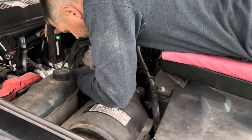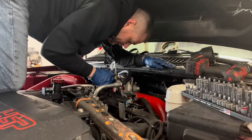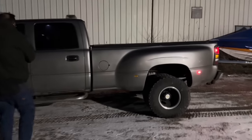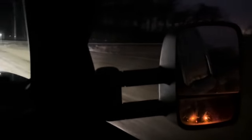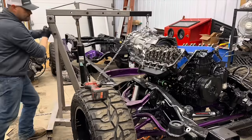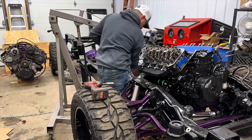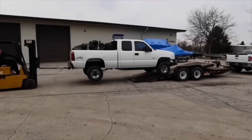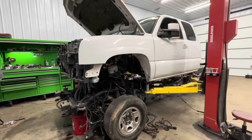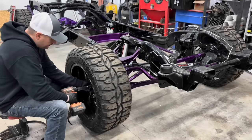Yeah, that's what we find a lot of. With the older trucks, guys will roll the dice on these things. We'll see - usually they're complaining about a lopey idle. But in the newer trucks - and I still consider a 7.5 a newer truck - we still find guys that if they're at that crossroads of paying us the labor to put a regulator in and paying for the regulator, nine times out of ten you're only a couple hundred bucks away from just getting a whole complete pump. Either way, we still got to strip stuff down to get to it, so you're only talking a couple more hours. Most guys just say screw it, let's throw a whole pump at it and we don't have to worry about it. Yeah, you've got to tear basically everything off from the front top of the engine just to get to the regulator.